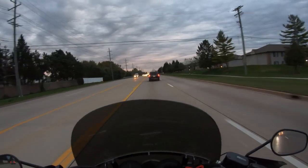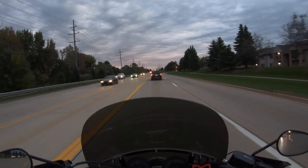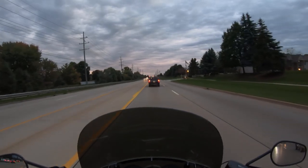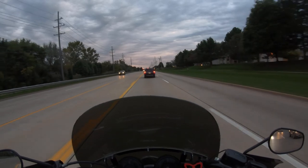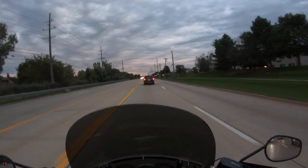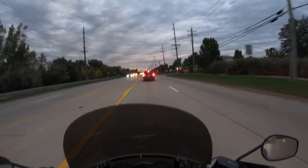With the touring models, what you can do is take your oil cap off, look at it, figure it out, drill it, tap it, and put a breather on it. That's the cheapest method. That's what you should do. Ripping apart your motor to do that is meh. But when you have no relief of that pressure, oil can't flow through because it's pressurized.